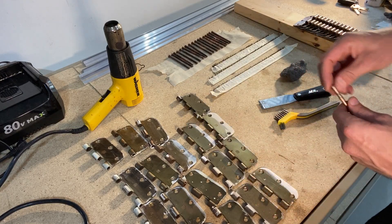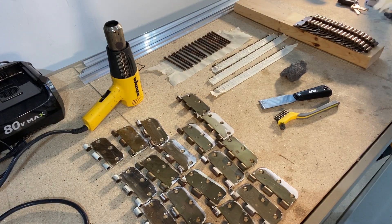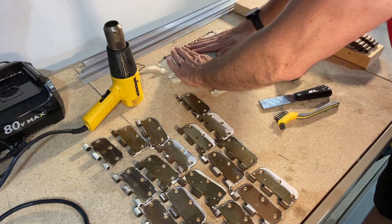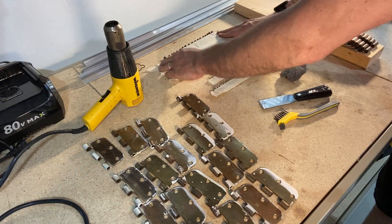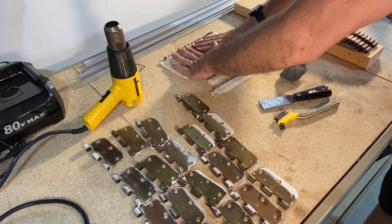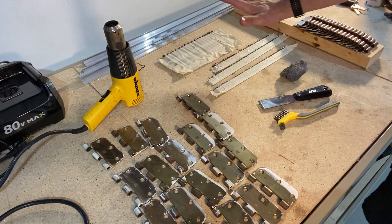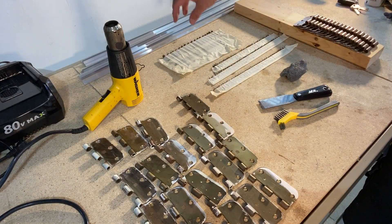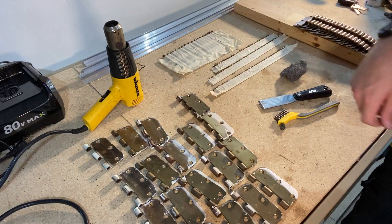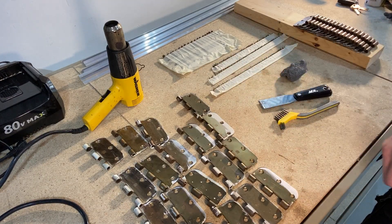For the pins, I simply took some steel wool and rotated the pins back and forth through it to clean and deburr the surface, making sure they'll fit back in the hinges. Then for the heads — since that's the surface we're going to paint — I used the stiff scraper to scrape off any excess paint. I'll cover the body of the pins with masking tape because I do not want to paint the body, only the heads, so they fit back into the hinges without issue.